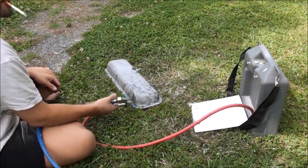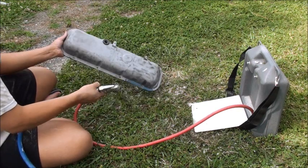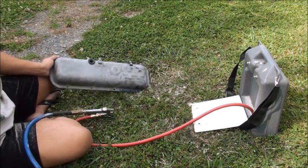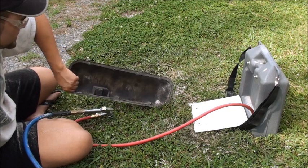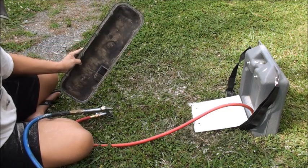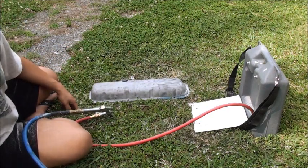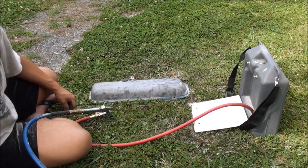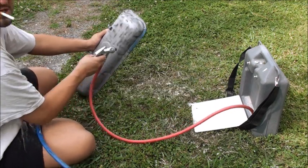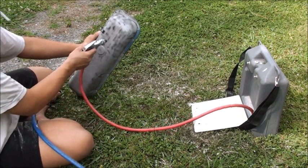I've probably got them down far enough to where they'll paint and look nice — I'll get all that black off. I'll get some more of it off eventually, but we're getting there. Before somebody says something about it: I've got enough sense to wash these, pour Purple Power on them, and pressure wash the living sun out of them to make sure there is no sand left. Don't tell me I'm going to get sand in my engine and ruin it. I wouldn't even want to sandblast an engine block, even though they are sand-cast. You've got to be careful — wash it, blow it off with compressed air, and it's going to rust in a heartbeat.